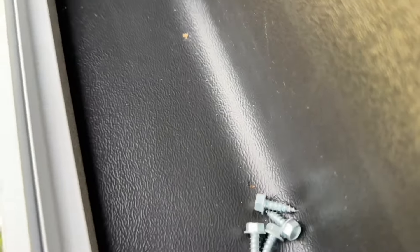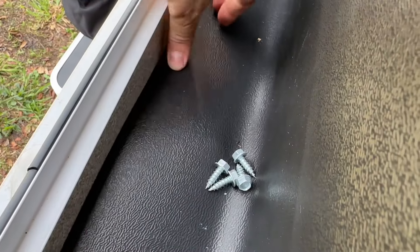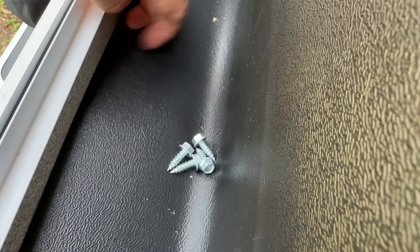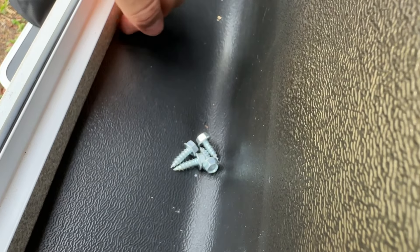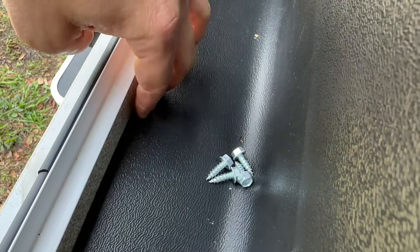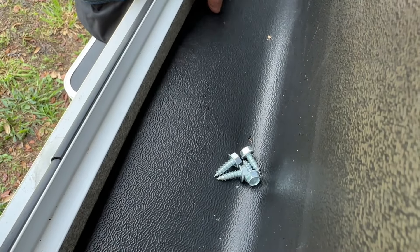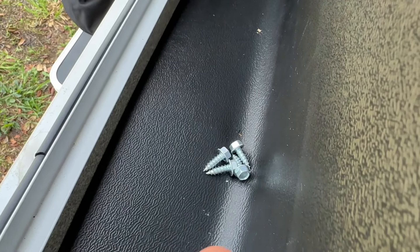All these TVs use this plastic-y material, but it's not bolted — it's not sealed to the outside wall here. There's no seal. So water comes in and it just weeps down here. If there's a seal failure or this is left open and water is getting in, it's just going to seep and seep. I have a video on my channel of an RV that only had 6,000 miles on it, meticulously kept, that got killed because of a problem inside this TV bay.